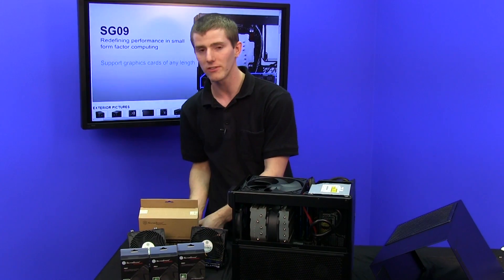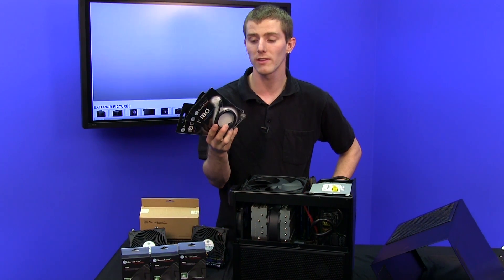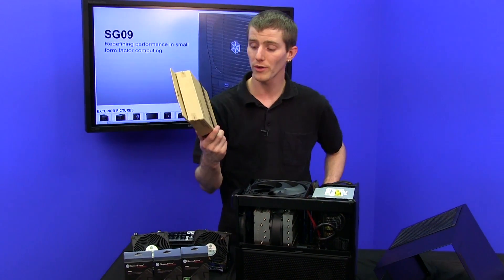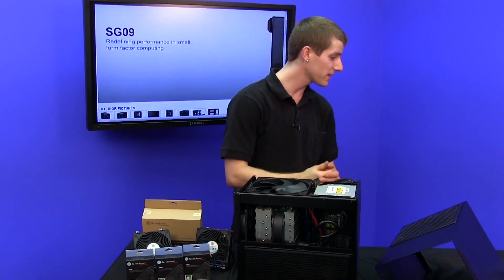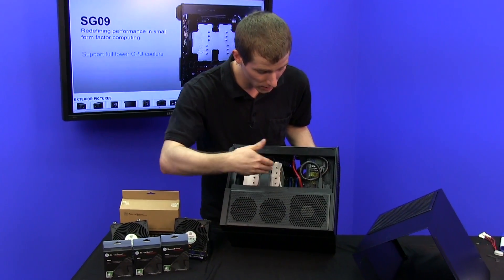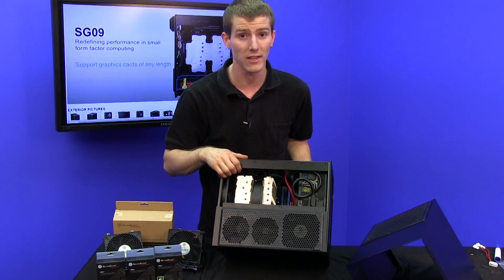The things that can make your life easier: the CP07 cables are short SATA cables — we had some short ones lying around, so you can grab a couple of those. I can't emphasize enough how important it is to get the PP05 short cable kit for the Strider power supply. If we'd had to contend with a full-length 24-pin ATX connector in here, we would not have had a lot of room left for airflow, which is incredibly important in a chassis like this.